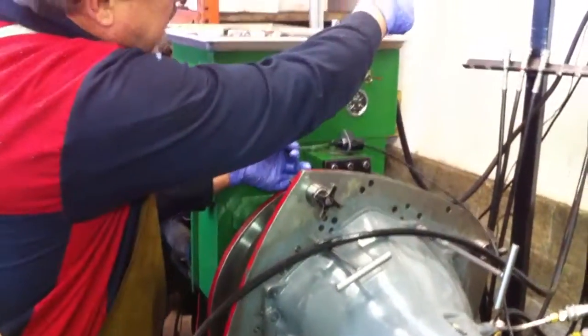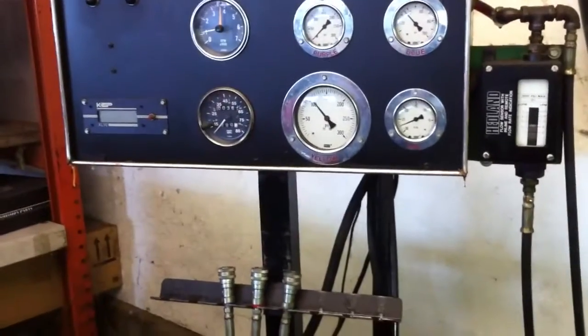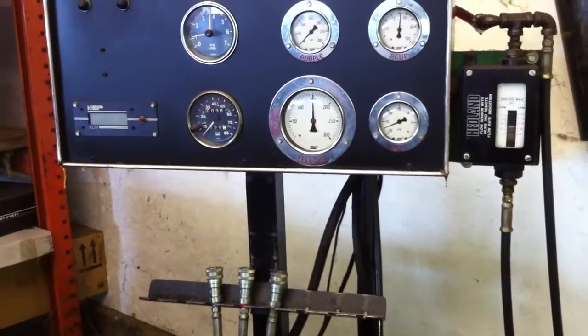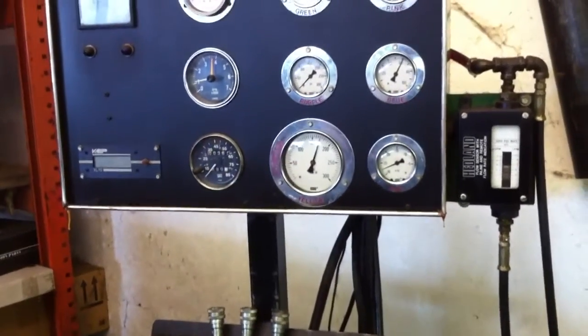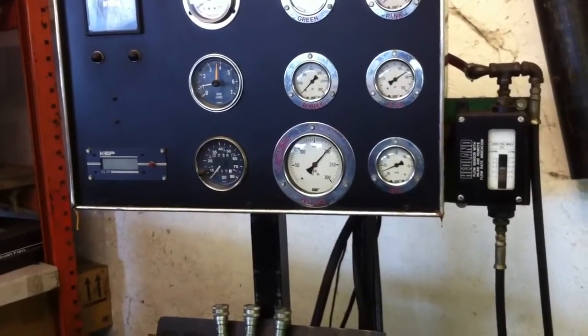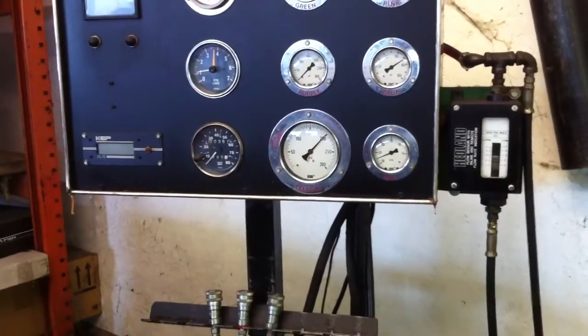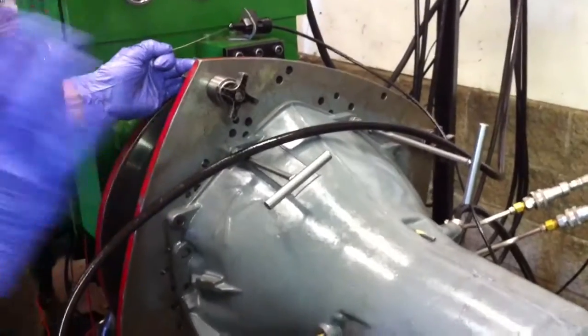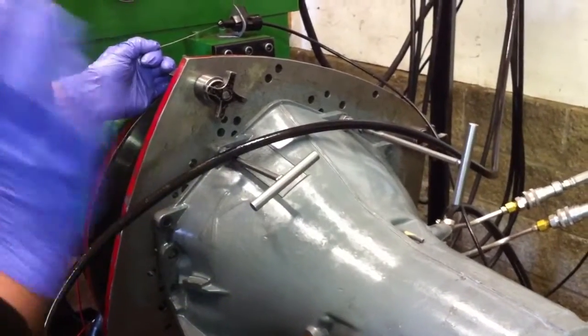When I pull on the throttle cable, we're at 85. I'm pulling very gently and it's climbing to 90, now it just climbed to 110, now 130, 150, 160, 170. Max, I'm at 200 psi. So 200 psi is something I was never able to accomplish with the transmission in the van, because of the throttle cable setup and the geometry. I'll show you the pressure readings I was getting in the van.